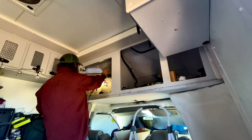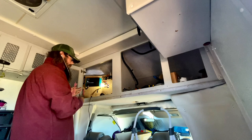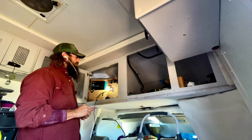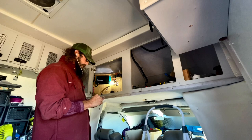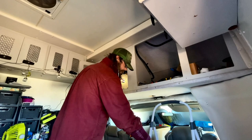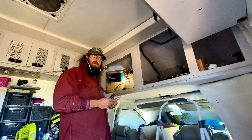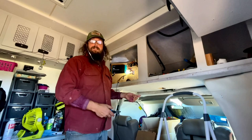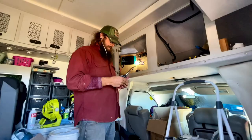There's going to be a fuse breaker here. We're designing a system that you could add solar to later, but it will have the ability to plug into a 30 amp connection and charge, as well as the DC to DC inverter running off of a 200 amp hour battery. There's some boondocking potential there. Maybe solar will be added later, maybe it won't, but at least short term this rig will be capable of boondocking without any solar power. It is possible to boondock without solar — you have to set everything up properly. In a rare case, you could plug into a 30 amp and charge your batteries, run that microwave, and then hit the road again.